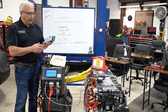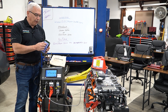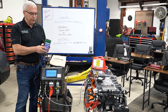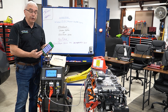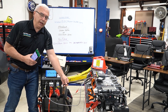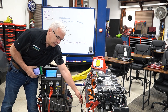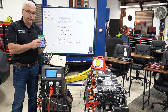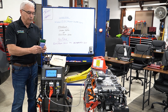Here I've got a makeshift battery — individual battery cells all inside of a module, and I've got four modules in that high voltage battery pack. In order to drain each and every cell and get a very accurate report, I'd have to hook up all these different wires to the actual cells themselves. Nobody's likely going to take the time to do that — it's very cumbersome on a high voltage battery because you don't have access to the cells. You might have to take the tops off the individual modules, whatever the case happens to be.